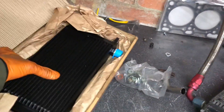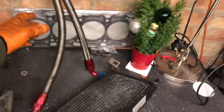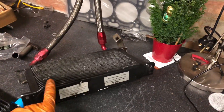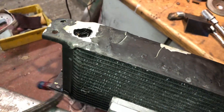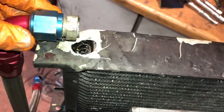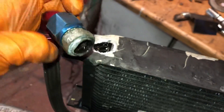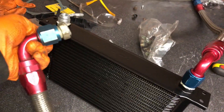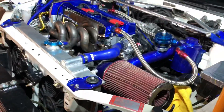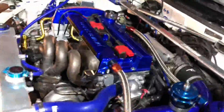There was no way I was going to reuse this oil cooler once the bearing spun on the crank — it fills the oil cooler with bearing swarf. So I've bought a new one — these are genuine Mocal oil coolers, not cheap, but they've got AN fittings on top so we can reuse the AN lines from the old one. The old one had seen better days — a bit dented. Getting the fitting off has been an absolute nightmare: it's completely seized, I've had it in a vice, heated and cooled it, and ended up crushing it to pieces.